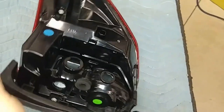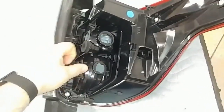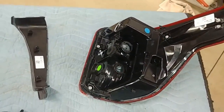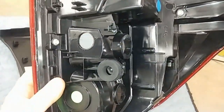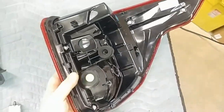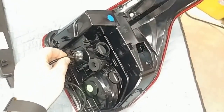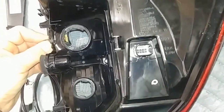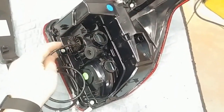Once you get the light out, this rubber piece just pops right off — it just lines up with these little tabs. Get that out of your way, and this is where you're going to drill your hole. This is about the easiest place to drill — a nice flat surface, easy to mount a hideaway right there. You can use any of our hideaways: low dome, high dome, doesn't matter. Here's a high dome for instance — mounts right in there. Plenty of room, no issues at all.